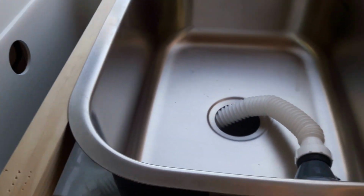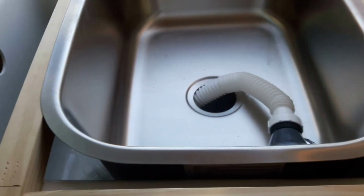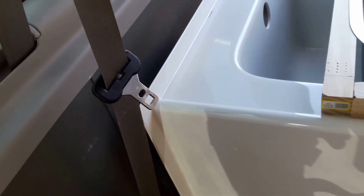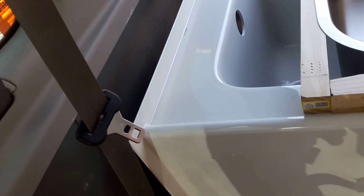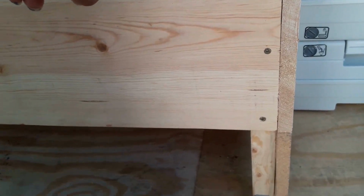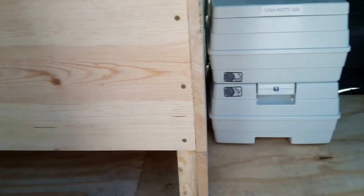Your sink frame is going to have a sink top drilled with a sink hole. It's going to have the same white covering to keep the water away from the wood. Then I'm going to start doing my bumper trim. It'll also have the white framing. I'm going to use thin plywood to frame it out, bumper it out, and then use this same stuff right here to cover it. I like it. It'll be completely clean looking on the inside with the white vinyl. It has a nice thickness, and it cuts good too.